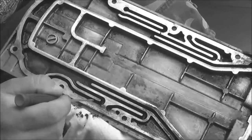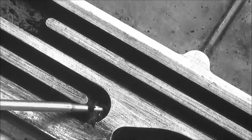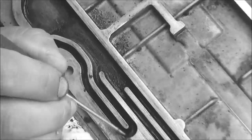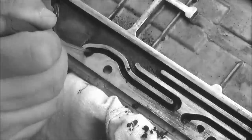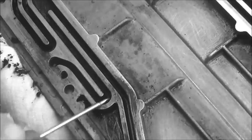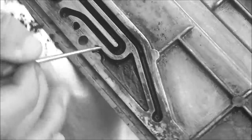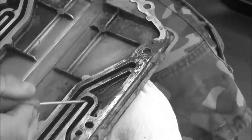I want you to see the process as I'm going through it so you can see what I'm doing. Like I said, I wanted to show you in detail. You can see all the gunk and carbon buildup coming out of here — make sure you get all this, especially here, because this is where the ports go and you blow that air through the manifold.